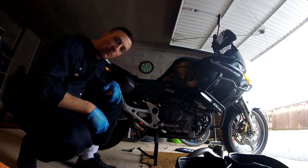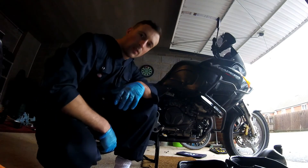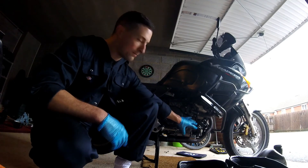Okay, so we were in the middle and we've gone back down right to the minimum now, so we'll put some more oil in and get it back to the middle. I've started the bike up again — it's all perfect, right on the maximum level. So all we need to do now is put our sump guard back on and job's a good'un.